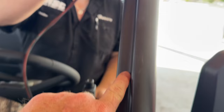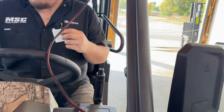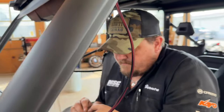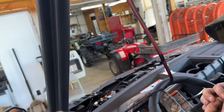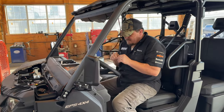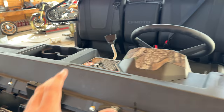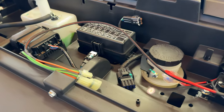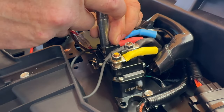In the instructions, it actually routes it right along this channel, but if you already have a windshield you'll know that's going to be in the way, so we're going to route it right up here. Harmon is already cleaning the surface with the included alcohol wipe — make sure it dries — and then he's going to put it out there. That simply helps us have a nice and neat install. We've got some zip ties and we're going to route that right along down the channel there. It's going to be on the inside where you will see it when you're riding, but from the exterior you're not even going to see it — a nice clean install. Before you make any connections, you want to disconnect your battery so we don't have any issues of accidentally shorting anything out.